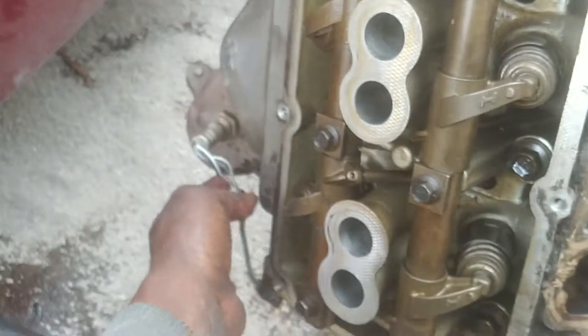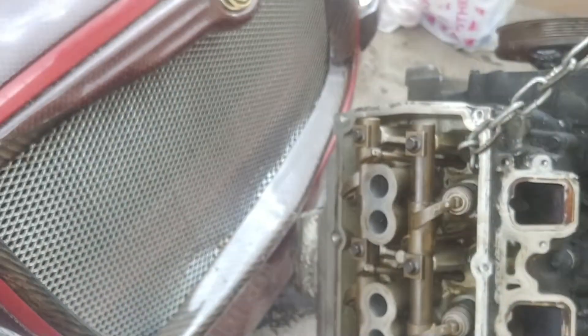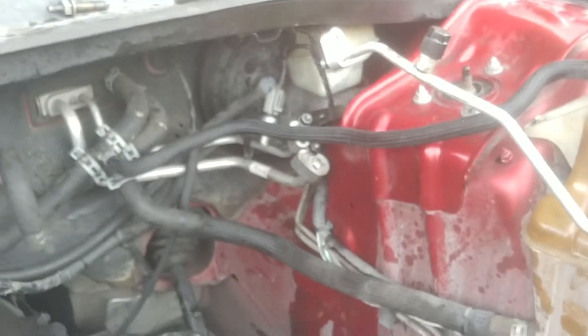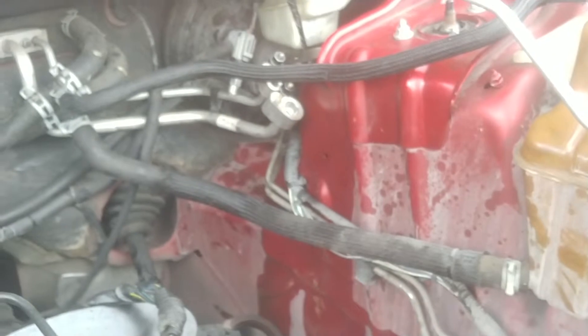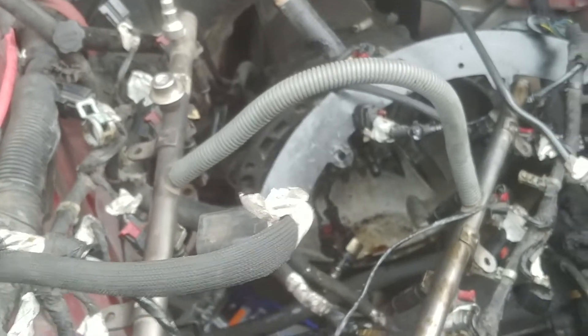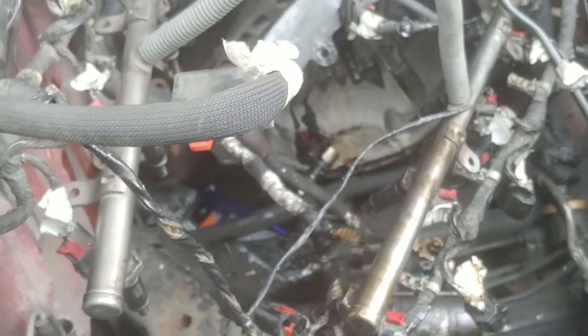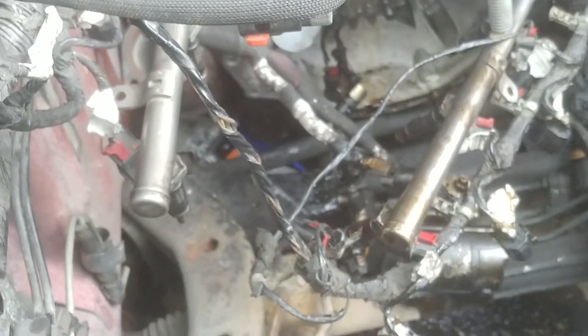You've got to undo the oxygen sensor plug on each side for the manifold — I pull it out with the manifold. I did end up taking my AC hose off, not on purpose; it just came loose, I unplugged it, and refrigerant squirted out, but it is what it is. Originally the goal was to get it out without messing up the fuel lines, and I was able to do that, so I'm happy about that. That's my one saved MDS solenoid down there — I was able to save one, so that's seventy dollars saved.